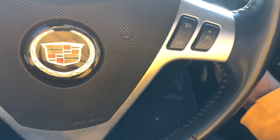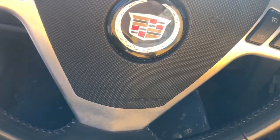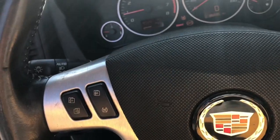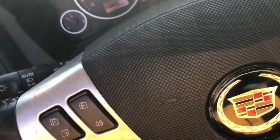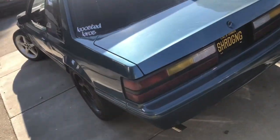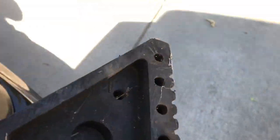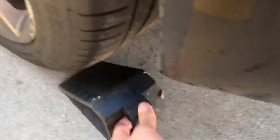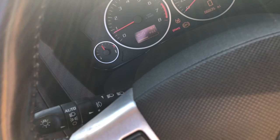First thing I like to do is warm up my car. When you warm up your car, your oil flows better because it's all warmed up — makes your oil change go by quicker. One thing you can do while you're waiting: go ahead and grab your wheel chocks and chalk off your wheel. If you're doing your oil change on an incline, make sure you put it behind the wheel so it stops from rolling back.